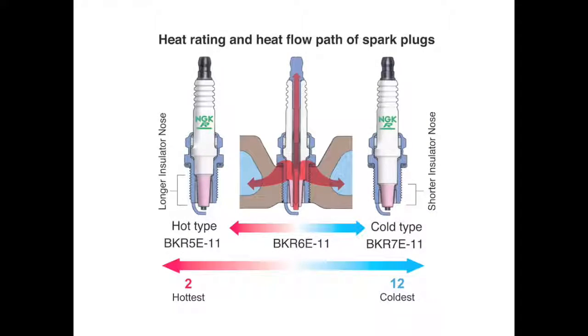This slide illustrates the difference between a hot spark plug and a cool spark plug. As you can see, there are different insulator designs for hot and cold plugs. The hot plug has less insulator mass near the thread shell, while the cool plugs have more insulator mass near the thread shell. A hot spark plug will have a slower transfer rate of heat away from the tip, while a cooler plug will transfer heat from the tip more rapidly.